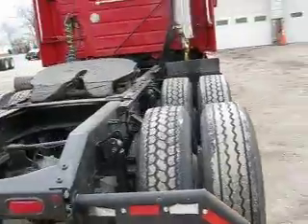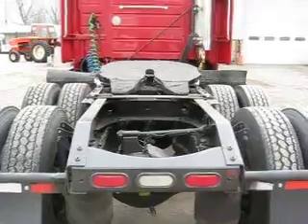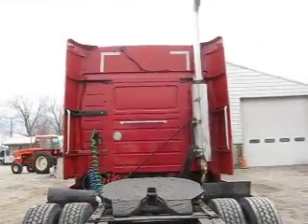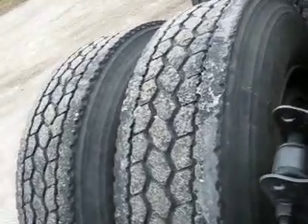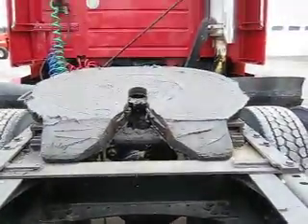Let's come on to the back of the truck. I'll let you focus on the tire tread for a moment. Look at the nice clean frame, air ride cab and suspension, real nice clean back of the cab, and a really good exhaust system. Tires are repeated on this side — the tread matches all the way around. Let's get you a look at the brake shoes on the back drive axles. We have recent drums and recent brake shoes. Take a look at the rear diff — not all rusted up and not slobbered with oil and grease. And again, folks, it's not been washed. This fifth wheel is greased and has been hooked to a trailer today.